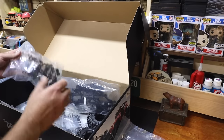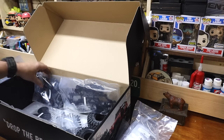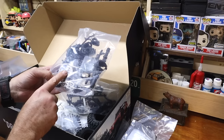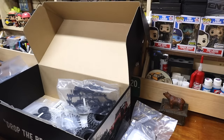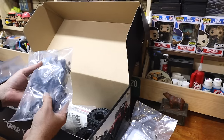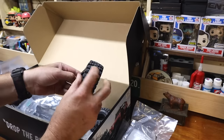One seat out of the CJ weighs about a metric ton, and these don't weigh too much at all. So there's a bunch of drive shafts, all the screws in their own pre-marked little bags — nice. Definitely axles, because that feels heavy. We will get to see if they have improved their rings and pinions. They're sintered and we've had some explode in the past. And this is definitely the gearbox.